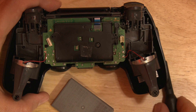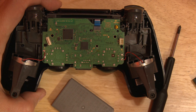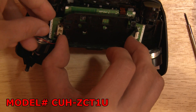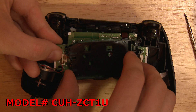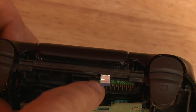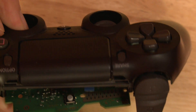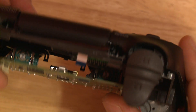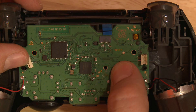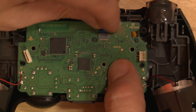Remove the battery, this screw, and the housing. If you have model number CUH-ZCT1U the battery plate is held in place by these little tabs in the upper corners. Remove this ribbon cable. Pushing the thumb pads will help the circuit board pop out. These contacts go to all the buttons on the controller. There's a chance that if the controller was dropped or thrown it might not be lined up properly with these solder points. Just line the circuit board up and push it in the whole way. This ribbon cable comes from the touch pad. Put that back in and everything button related will be back in correctly.